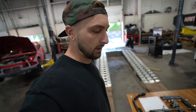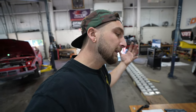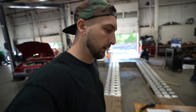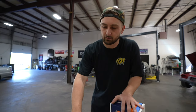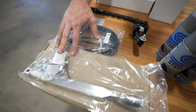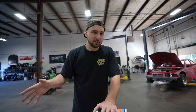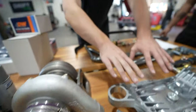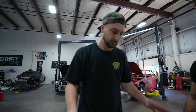This is the drift kit of the E36. E36 BMWs don't really take much to be a really good drift car. We have our D-Swerks package — a full surge tank for the E36 since we are using a stock tank and fuel slosh is an issue when drifting. On top of that we have our hydro, our lines, our shifter, all new components to make this thing feel dialed. We also have the new turbo, which we'll talk about later, all our components to make our diff ready for drifting. The big piece for today is the SLR angle kit.